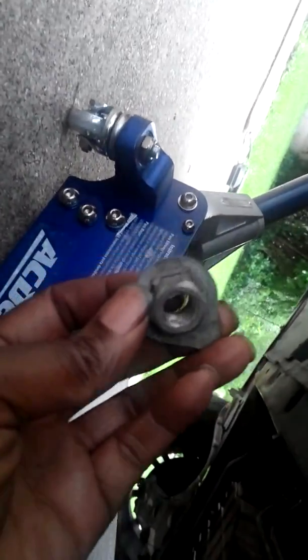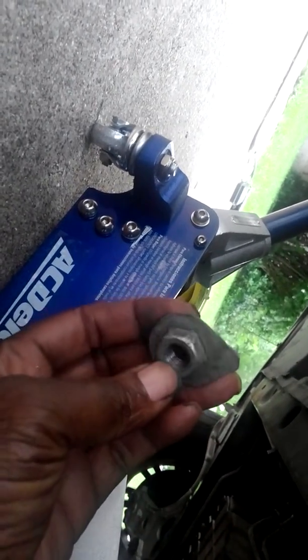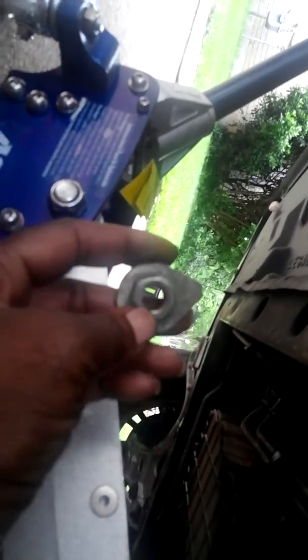Just a little trick for that. Both of these are the same way. I'm going to put the camera down so I can get the work done. I got one of them off — this is what it looks like. It's a nut with this blocker on it. It's only going to spin so far because of the cradle that it sits in — it goes up to the top of the lock. So you have to basically unscrew the other side because of that locking mechanism built into that nut.